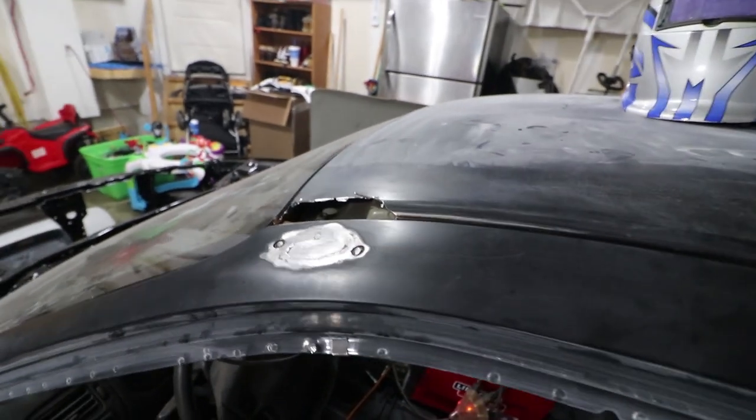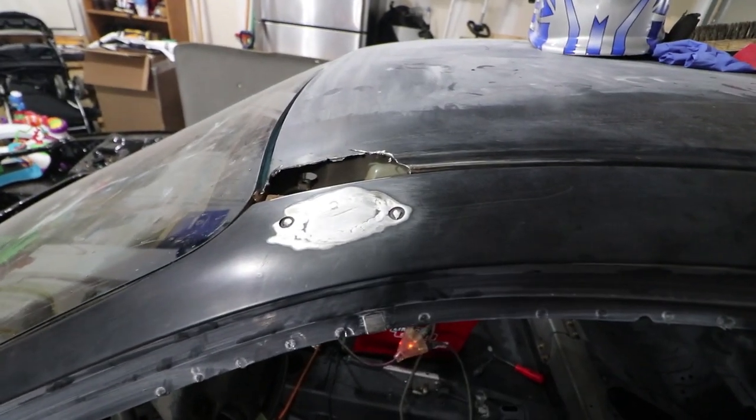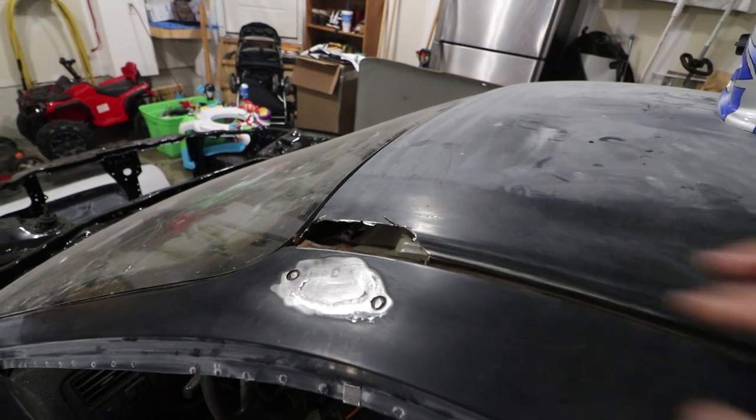I ended up welding that patch in flat, didn't round off the piece, tacked and welded everything down, then ground it all down. Pretty happy with the results. That small section is gonna be quite the challenge tomorrow, but I'll manage. That's going to wrap up this episode — still a couple of bodywork things to do but nothing that should slow down getting primer on the car. The door jams are done; just that small hatch section below the window still needs sanding. Once everything is cleaned and masked off, I'll be ready for primer. The goal is this weekend. Thanks for watching and I'll see you in the next one.